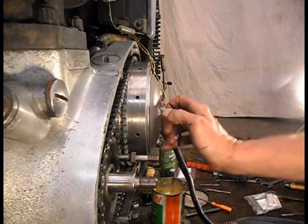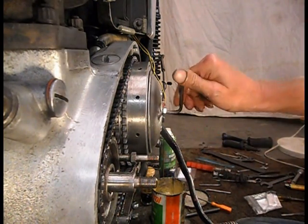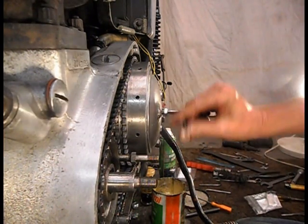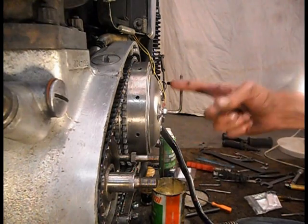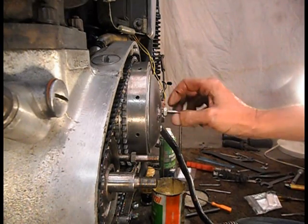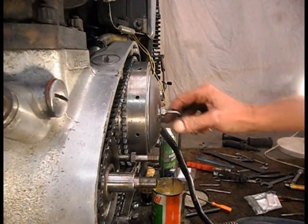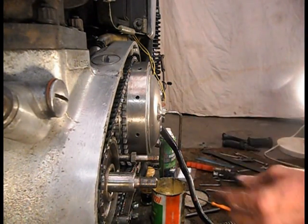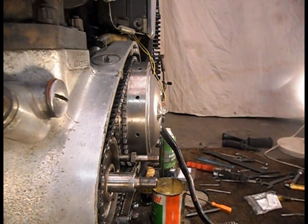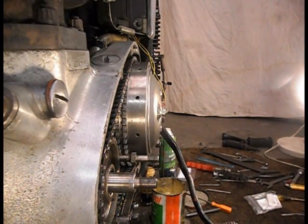Let's wind that in. Pull that back a bit. Right, you see I'm pulling the plate off there? Right, slack. That's touching the push rod there, and I want that back off about 10. Now I've got an adjuster, I can do this without taking my case off. Adjust my clutch cable and then see if I can pull it. Oh, I've got a clutch I can pull.